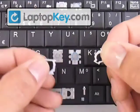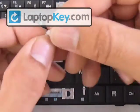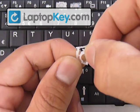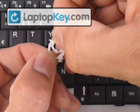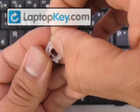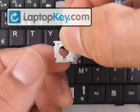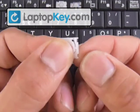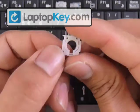Now we know the position for both pieces. We're going to put the small piece over the large piece and insert the left pin into the left hole on the large piece. At the same time, put the bottom bar of the small piece underneath the bottom bar of the large piece — you have to do both at the same time. Once those are in place, hold the corner down so nothing comes out of place. Then insert the other pin into the other hole by separating both pieces slightly so the pin has enough space to go into that hole.